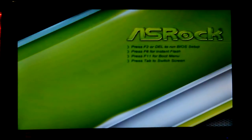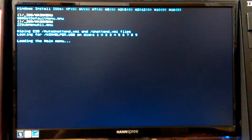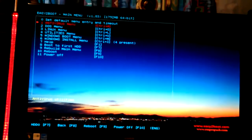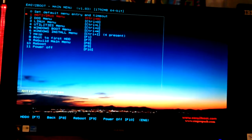That's the weird, I'll just say bug for lack of a better word, in the ASRock. Auto recognize setup. And there is no manual setup in there to tell it boot to this or boot to that. At least not with the USB. I think you can tell it different types of drives, like hard drives. I don't think you can say boot to CD or boot to USB always. On some machines, that's what you have to do, and then change it back when you're done. So other than that not always working,